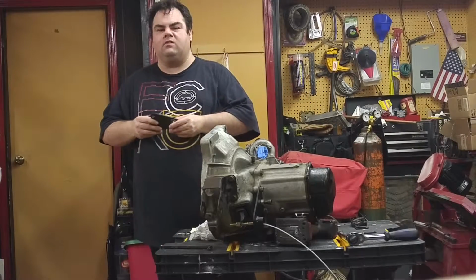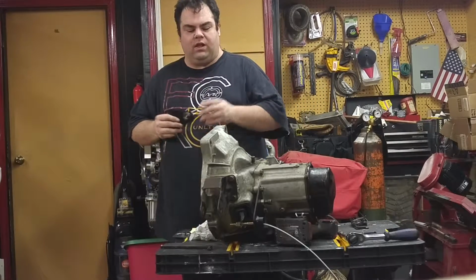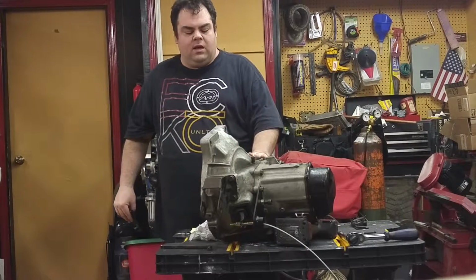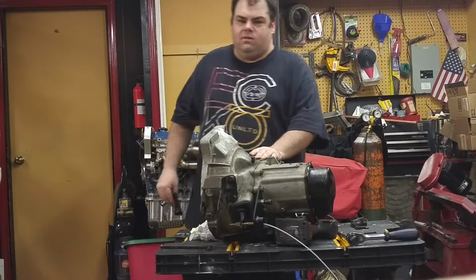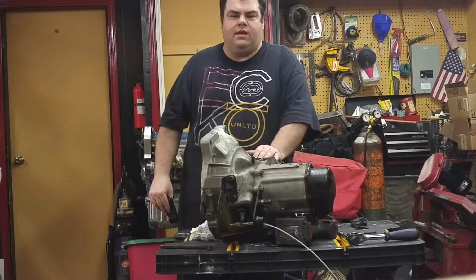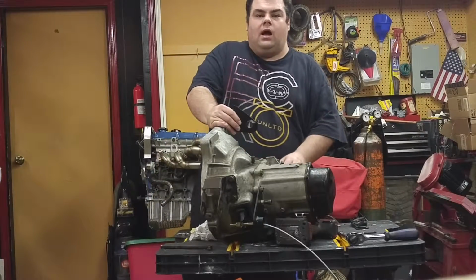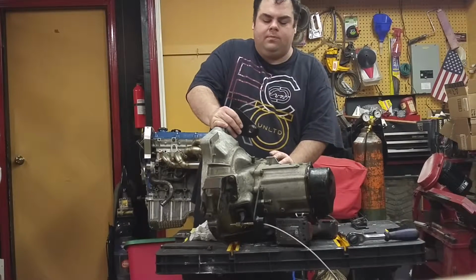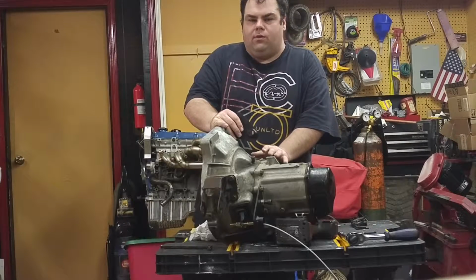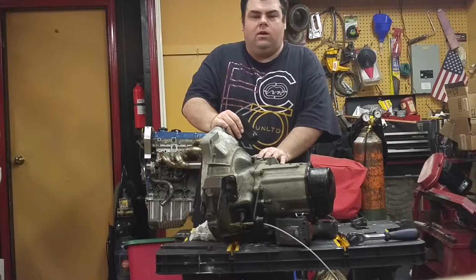Why this is needed is just because as time goes on, XR2s are getting harder to find. A lot of people, when they swap in the turbo motors, the BPs, the B6Ts, B6DEs, generally the go-to transmission was the Capri XR2 transmission or the 323 GT transmission, also known as the G15MR, which was a cable-driven transmission. It's a little bit smaller than this one. However, it is stronger than the Festiva transmission, but as I said, the problem is they're getting harder to find in junkyards. They were only available in the XR2 form and the Mazda 323 GT form, which are very rare.